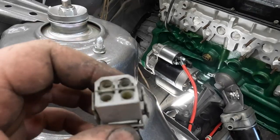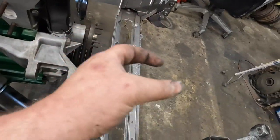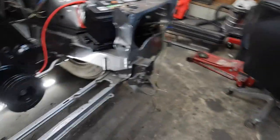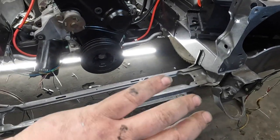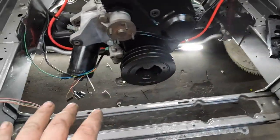On a diesel, however, this is the overheat fan relay. There's a switch on the radiator and then a fan that sits in front of the AC condenser in case she gets real hot — that'll click on and blow through a little bit. Might have to rework that with the intercooler going there. Some new battery cables, just generic ones from Rock Auto — you're going to want to measure them before you buy some, because this red one goes all the way across the crossmember over to the starter, as does the main engine harness.